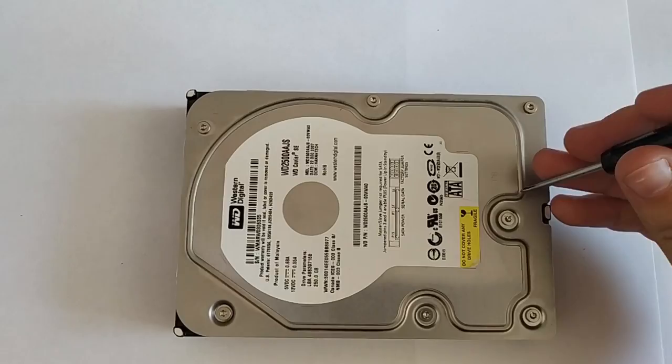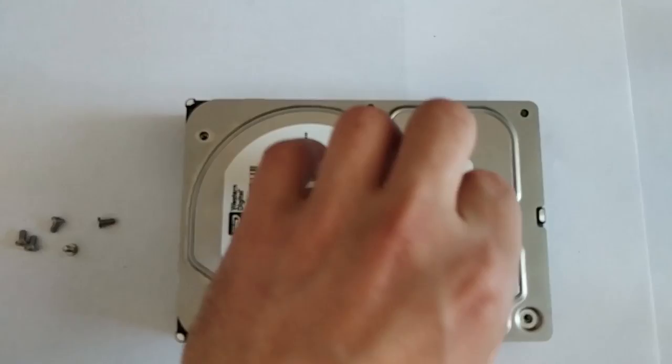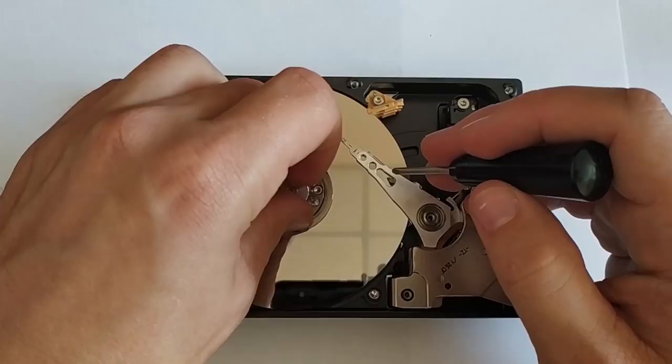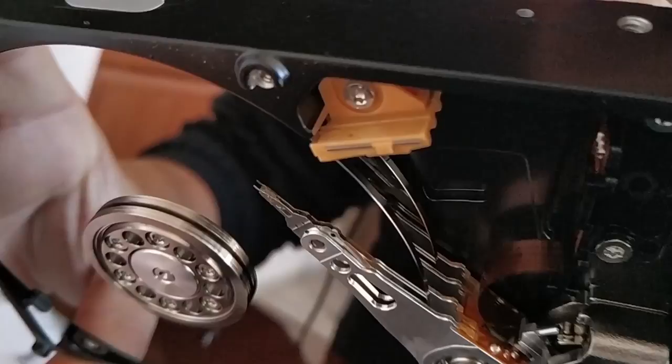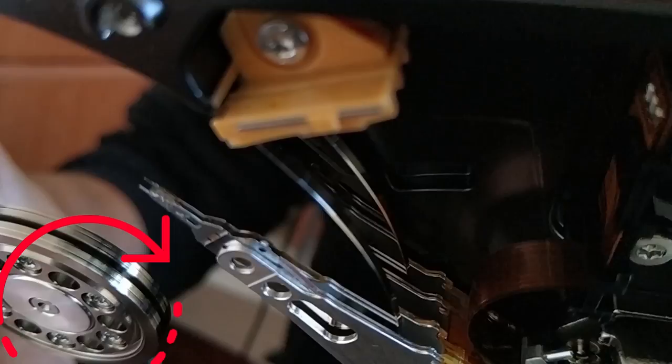To return the hard disk magnetic heads to the landing area, you need to take the hermetical block apart. First, open the upper part of the hard disk body. Then use a pair of tweezers or a screwdriver to move the heads slightly to the landing area while rotating the spindle in the right direction. To determine the correct direction, turn the spindle slightly and have a look at the contacts of the magnetic head — the cable should not be stretched, otherwise you risk tearing off the heads. Usually the right direction is counter-clockwise, but there can be exceptions.